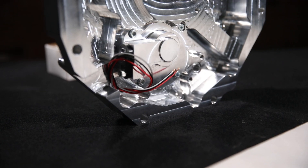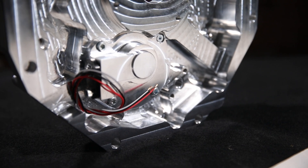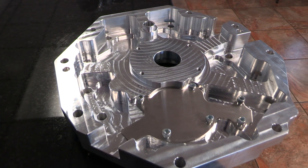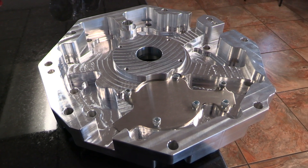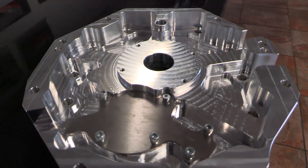Pricing will come standard as though you were running a 12-volt pump. You can upgrade to the mechanical pump, keep a stock pickup tube, or upgrade to the better pickup tube. We also have the new feature of an input speed sensor. This is going to be really appealing to the drag car guys. If you have the electric pump to spray fluid, you don't need the mechanical pump. If you get the plate without a pump at all, it comes with a block-off plate, and you can still use the electric pump with it or use it without a pump.